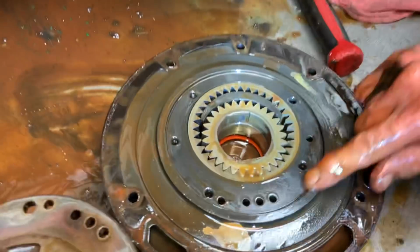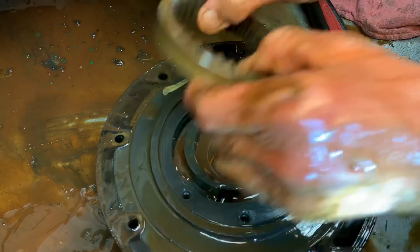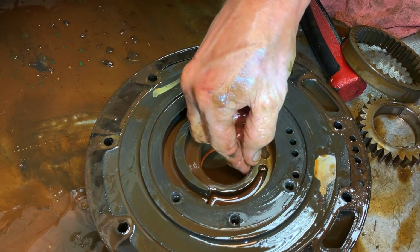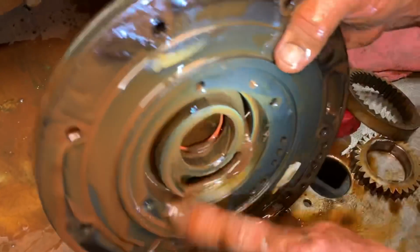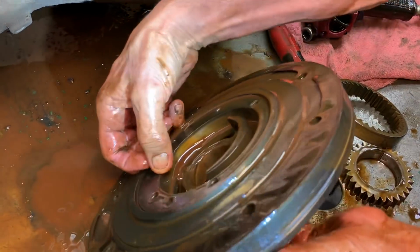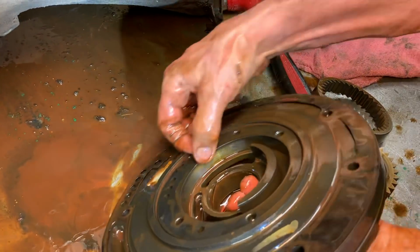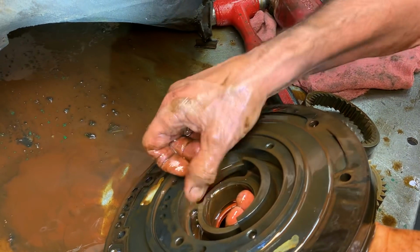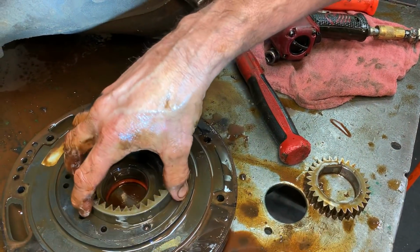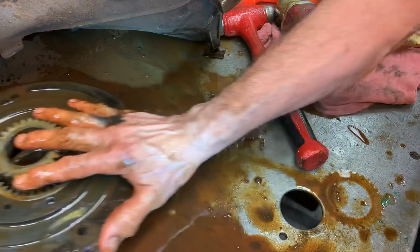And what's bad, this is probably a beautiful pump. You can see how nice it looks in here. The pump still could be really nice. Look at that. Actually, really nice. No grooves here. Bluing looks really good. Got a little bit of lightning through here. You can see how the bluing's still on here. You can tell the rust was starting to take its toll in the water. Water don't lubricate at all. I'm telling you, it just wipes the metal plumb out when it goes water, metal to metal. So, actually, it needs a new pump, complete pump.